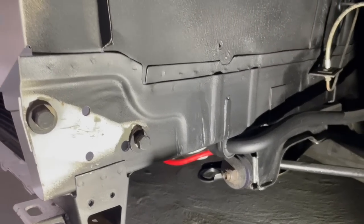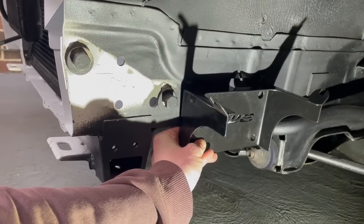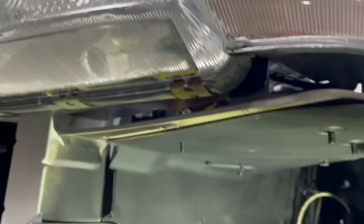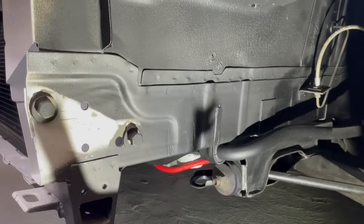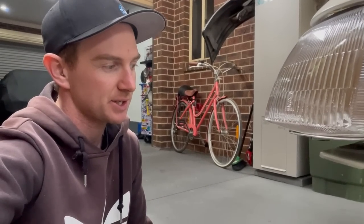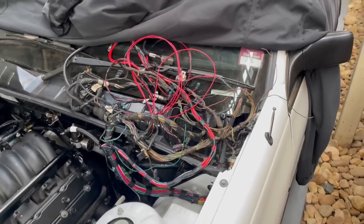The bracket is going to be mounted right here — it's actually the perfect size, fitting between where the bar rail finishes and the sway bar starts. Unfortunately because the pump is so tall I'm going to have to mount it with only two bolts, with the bottom of the bracket hanging below. If I mount it any higher I'd have to cut a hole into the engine bay, which I'm not doing. I'll nutsert-mount it like I did the dipstick. The mounting holes will be inside the rail so from the engine bay you won't see any mounting holes — very clean.